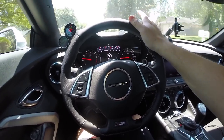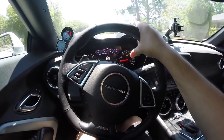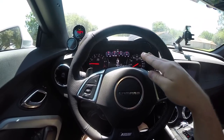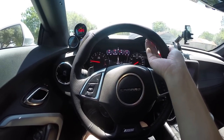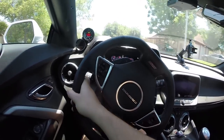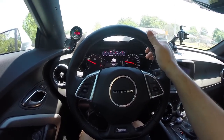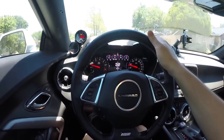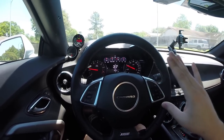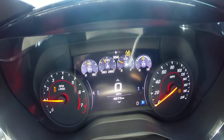The initial takeoff is a lot smoother — I think a lot of it has to do with idling about 100 RPM more, so the car has an easier time launching. Brett has his setup in Tour mode, so pretty much in touring mode the car will be at its optimal position — that's how we'll run it at the track too. Even taking a turn compared to Pat G's tune, just taking off is a lot smoother. Now let's see how it does in the quarter mile.